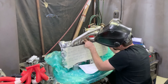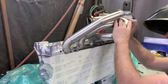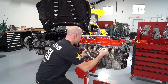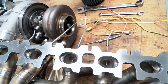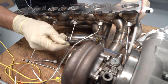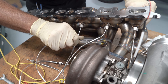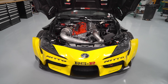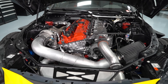It's crazy that we went through all this work on the 3D printed header and didn't actually end up using it, but we will use it in the future. We were a little concerned using cutting-edge technology at the last event of the year. After adding our EGTs — exhaust gas temperature sensors — and a fitting to monitor exhaust gas back pressure between the exhaust valve and the turbine wheel, we had the whole car running again. Then it was time to get it off to the dyno and get everything tuned up with our new header and turbocharger setup.